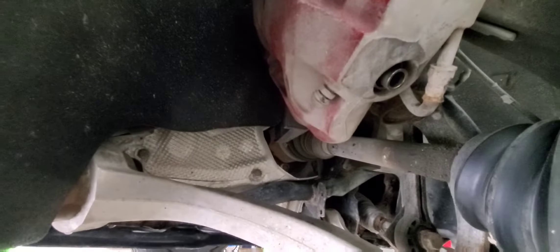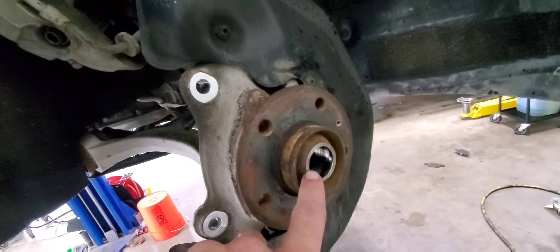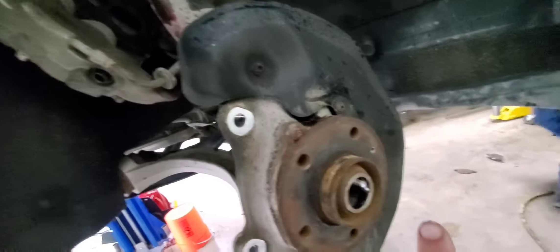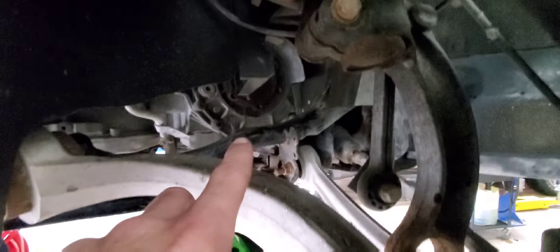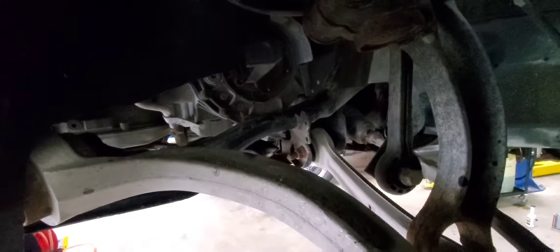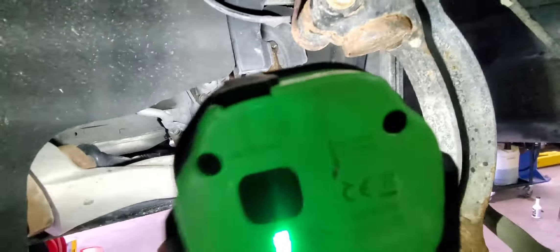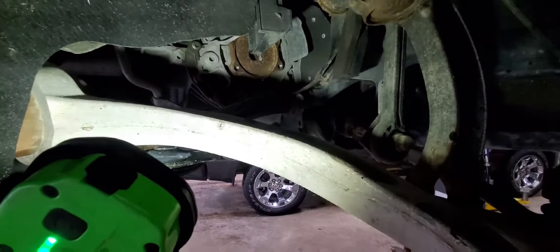If I find anything else video-worthy I'll record it. Easiest way: pull the nut for the hub on the axle, pull it out about halfway, hammer it, push it in — make sure you get a new nut so you don't mess it up. Then pull those M10 bolts. All you're gonna want to do is pry a little bit — don't pry too hard against the transfer case or output case for the CV axle. Just tug, spin, tug, spin and it should pop right off. This one was pretty seized because it's rusted, but we did get it out.